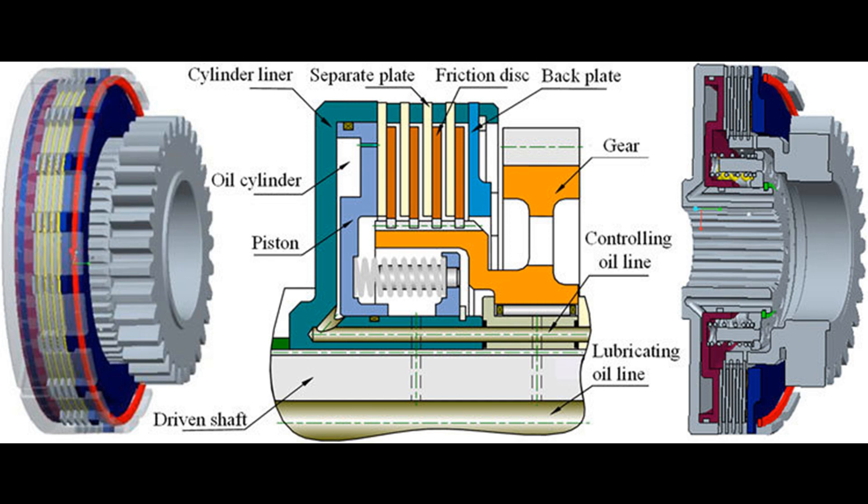Types of multi-plate clutch. 1. Spring-type multi-plate clutch. In this type of clutch, a cover attached with the flywheel of the engine is used, inside which the multiple clutch plates, pressure plate, thrust bearing, etc. are packed. The clutch plates are placed over each other and mounted over a spline shaft. A pressure plate is used which has an outer sleeve connected to the pedal fork such that pressing of the pedal will move the pressure plate outward in order to disengage the clutch. This pressure plate makes contact with the clutch plate pack to engage the clutch, and release of this contact results in disengagement. The engagement is maintained by the stiffness of thrust springs placed in circular fashion behind the pressure plate; compression of these springs causes disengagement. This type of clutch is used in old cars and bikes.